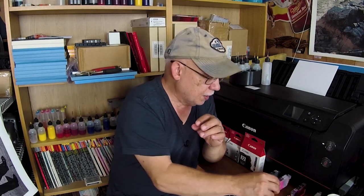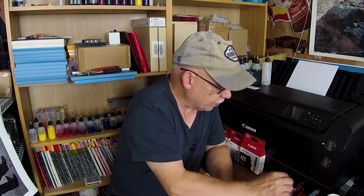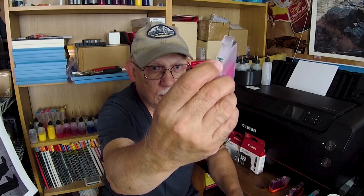If you don't get that right, you're going to have a problem cartridge. If you want to flush your cartridges, you can do so — many different reagents work; I just use Windex. It's not necessary except for the yellow cartridge, and most providers will not give you a replacement yellow cartridge. If you buy inks from Precision Colors, they'll give you a flush CLI-8 cartridge which is physically identical to the CLI-42s. Carefully remove the chip — there's a little well spot you scrape off with a razor blade — then attach it to the replacement cartridge. That will be your yellow chip.